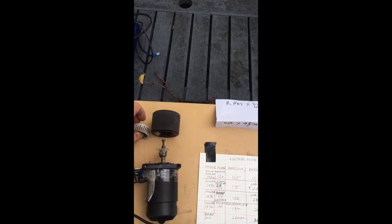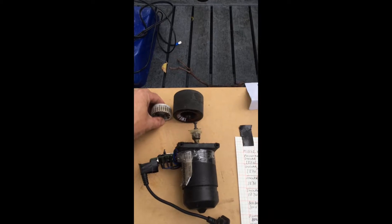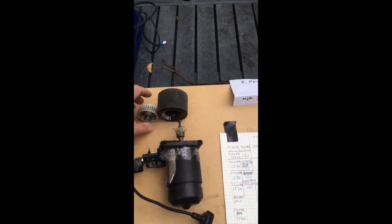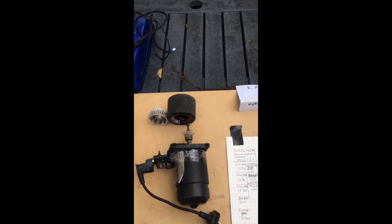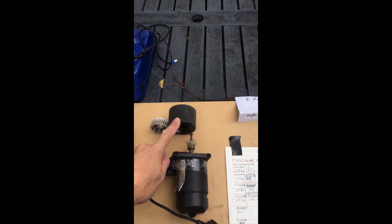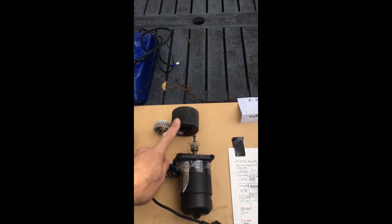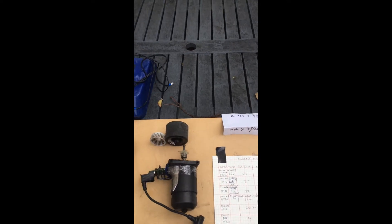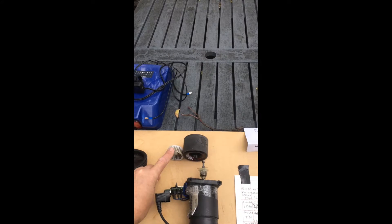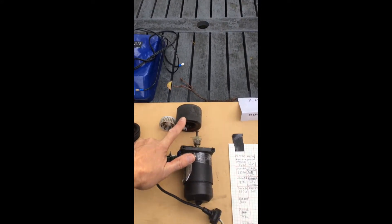There's a third possibility I'm playing with at the moment — an aluminium billet which I'm going to have machined to the right size. Notice the height difference. The smaller pulley was great at lower speeds, but what I was after is smoother top end speeds. I tend to use pedal assist when I pull off and then this takes over. But the smaller one was far better when the weather was damp — today, a damp November day, it was really rather inefficient.